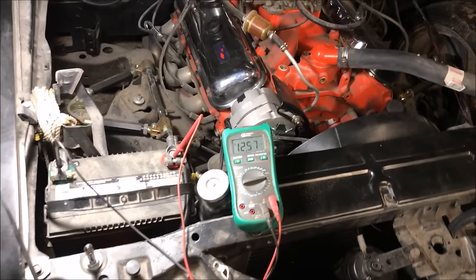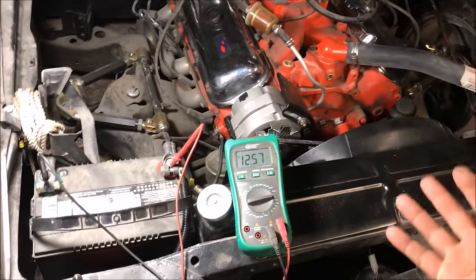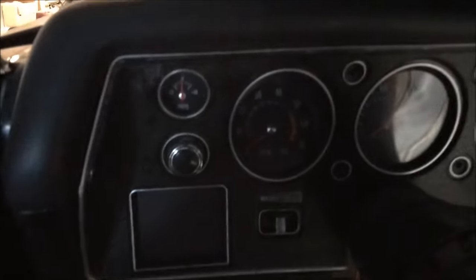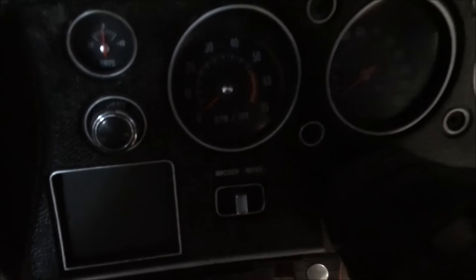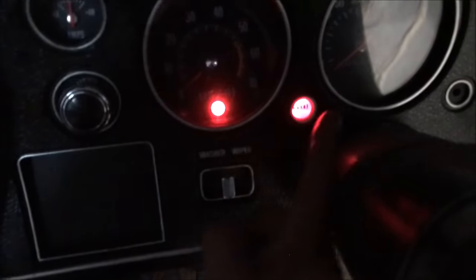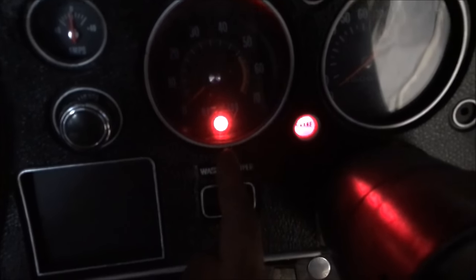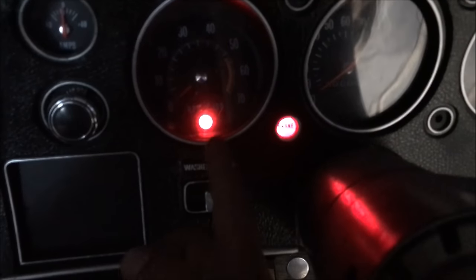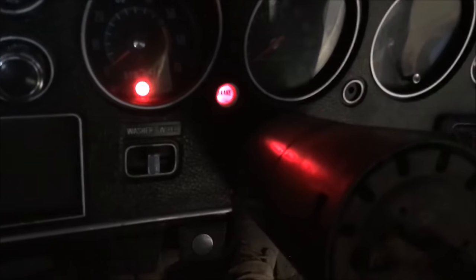Plan your project ahead of time. On this car we're definitely going to be doing vintage air, fuel injection - I think it's FiTech - and possibly cooling fans. That's why I'm preparing for this 100 amp alternator. I really don't see myself needing to go bigger, but if I do, that's why we went with number 4 wire - we could do the 140 amp no problem. I put the one-wire on this car because it does not have a gen or battery light. Turn ignition on - see that's the brake for the emergency brake. Remember I was talking about how you might have those switched - that oil pressure light will go off as soon as the engine builds pressure.